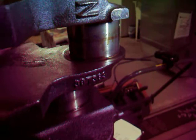This is a nodular iron crank — sort of about midway on the performance scale between the later cast iron ones and the legendary and very hard to find forged ones. For my needs, the car won't see anything much over 4,000 RPM anyway, really. Even with the steep gearing in the back, it's running with an overdrive. It'll do just fine with the components that it's going to have.